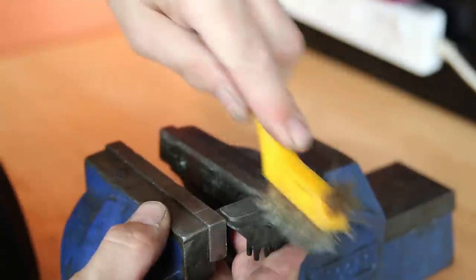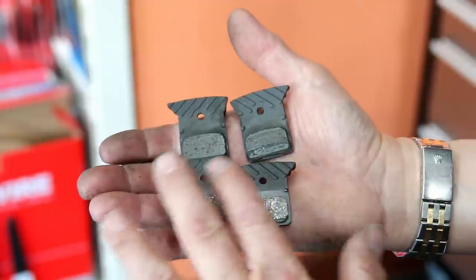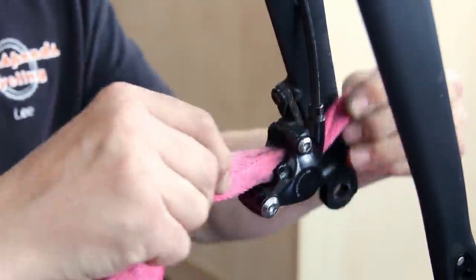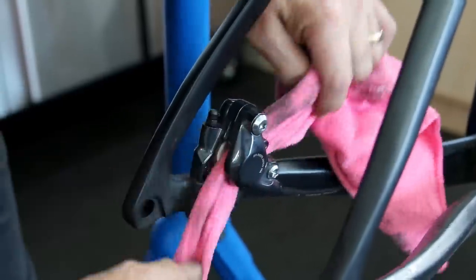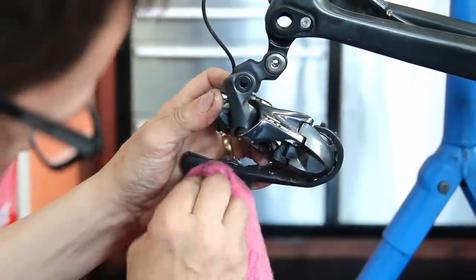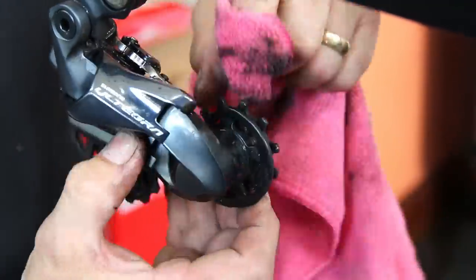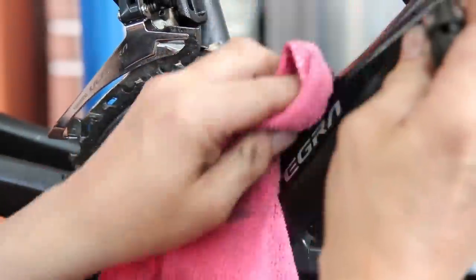You can see I'm just cleaning up the brakes now, keeping the pads fresh. You get oil that's already been on the chain - it gradually moves outwards with centrifugal force and can end up on your brake pads. You can see that top one has a little groove and damage on the pad surface. By cleaning them up regularly and giving them a little skim, you make sure that moving forward - we're in the summer here in the UK but this bike's going to move towards winter - so by keeping everything freshly cleaned and routinely serviced, as you go through the winter everything's just as it should be. It's those subtle finessing differences that make the world of difference to how it will ride moving forward.